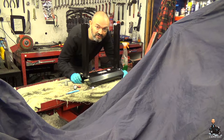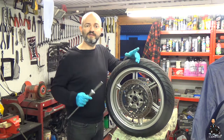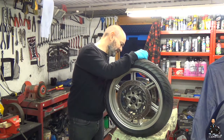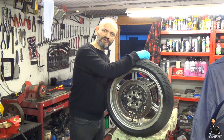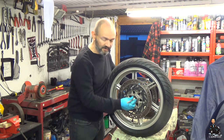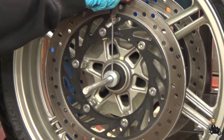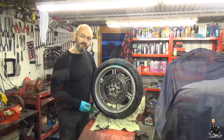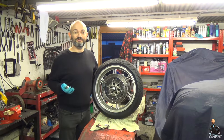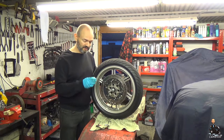That's the machine level, we're now getting on with balancing the wheel. I'm going to mount the wheel on the bar. I don't want to do this on the machine because I don't want to put any pressure on the bar itself — take the risk of bending the metal and ruining it. I'll just slide it through from one side. I've already tightened one of the cones on so it's nice and snug. Get the second cone and get that in as far as it'll go so the wheel sits on those cones nicely and then just nip it up. The machine comes with another two collars — not cones this time, just flat ones. I'm assuming these are just there to stop the cones jumping out and the wheel falling, so we'll use them.